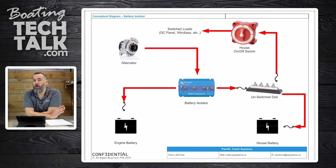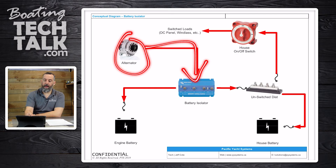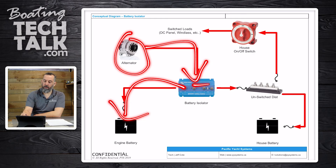Remember, Trevor: the starter still needs to be connected to a battery switch and an engine battery. Your battery isolator takes a completely different path — directly from the alternator to the battery isolator, and then from the battery isolator out to the batteries. That's basically how a battery isolator works, and if it's confusing, that's normal — it's not easy.